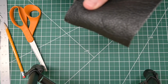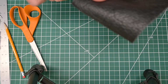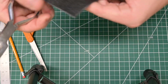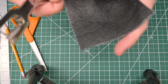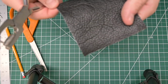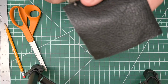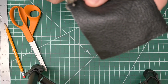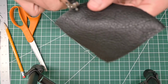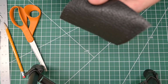And I sort of use the same approach when I'm leather wrapping steering wheels. The only difference is it's a lot more leather to work with to wrap a steering wheel than a little 3-inch long e-brake handle. And now I'll come through the other side, and this is why you really need to put a lot of pressure down, is to make sure that you can find your holes, because especially with black leather, it is really easy to lose track of these little guys. So we come through, boom, boom, boom. And the nice thing is, because the leather all kind of went through them, this point on this leather punch tends to center itself as you're coming through.